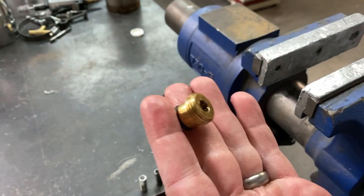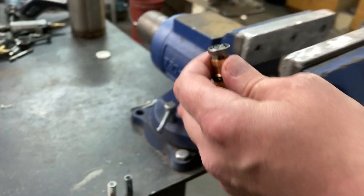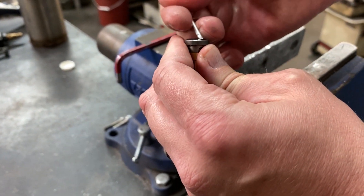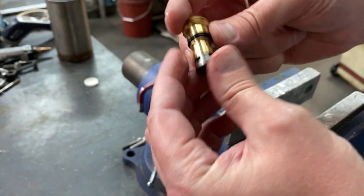This is the Haldex valve coming out of the rear differential — we're going to be changing the spring on the internals. We recommend first removing the o-ring from the rear of the unit using a sharp implement, a paperclip or anything, just pulling it out and making sure not to ruin it, then placing it to the side.